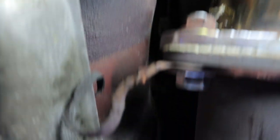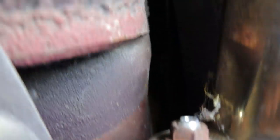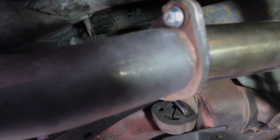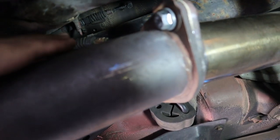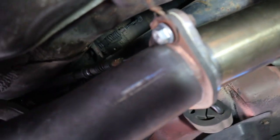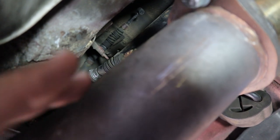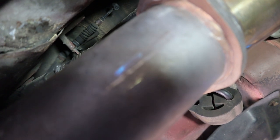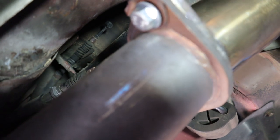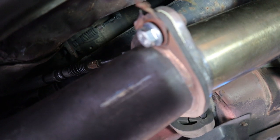I do know that this is probably something that would have required taking off the exhaust and possibly the power plant frame, but I'm going to see if I can just wiggle some of this stuff off. I really can't film much of it, but I'll check back in once I've got that off. Essentially what I had to do was pop the right-hand side cable out of its little bracket — my camera is not going to focus because it's too close. Mine had a lot of grime and crud on them, which made it a little bit difficult. If yours are grimy I'd probably spray this down with something like PB Blaster.